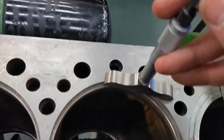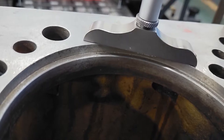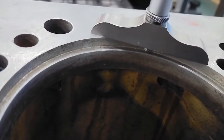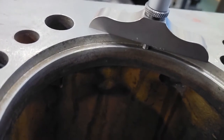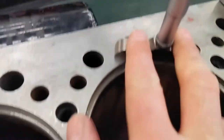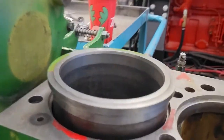You can put it across like this here, with the end of the micrometer down below. Make sure it's nice and square on the block deck. Then extend it, ratchet it down, and make contact. Any time you use a depth mic, you can see these nice grooves on this flange — put your fingers there and use two hands to extend it. Make sure it sits flat and don't reef on it; just have it extend as far as it needs to go.